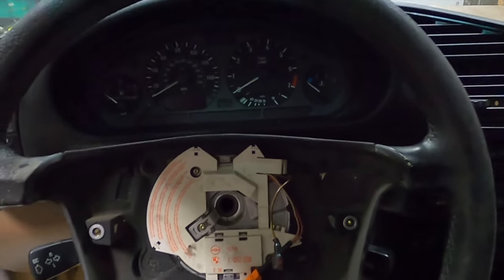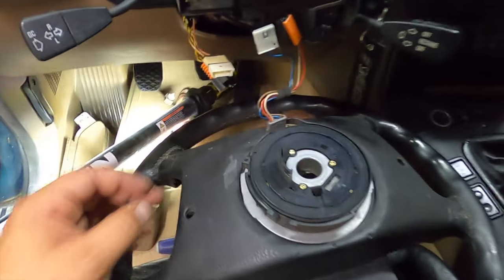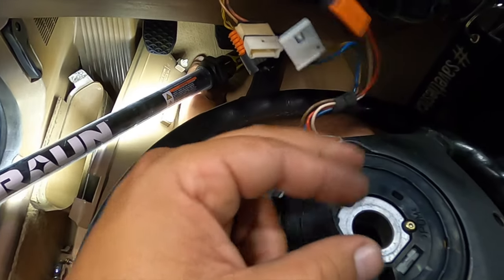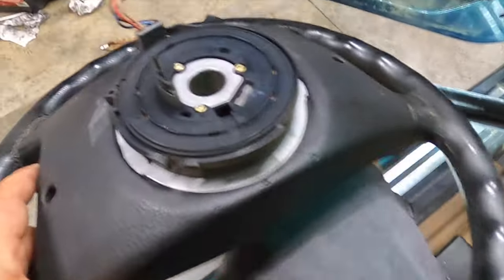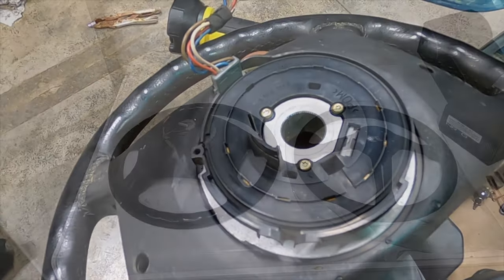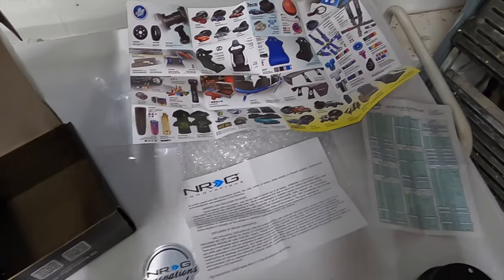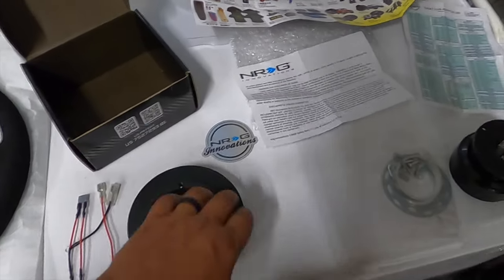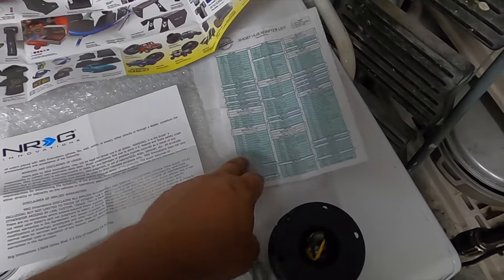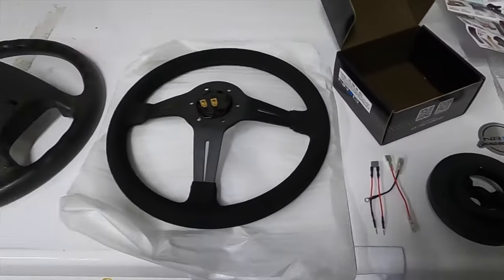You will have to disconnect some wires on the backside. Here's my steering wheel laying in my lap. The only other wire you got to disconnect is this white wire — we already did the airbag one — and then you can slowly go ahead and pull it off. We're going to get this little canceler onto the new one. I got everything laid out: old steering wheel, new one, opened all the boxes. There are no instructions, just a pamphlet for some new products, a warning disclaimer, and the short hub adapter. I've never done this on a BMW, so we're gonna learn.